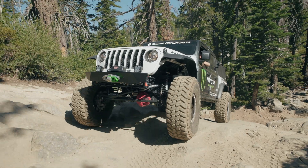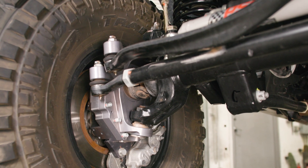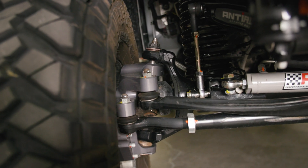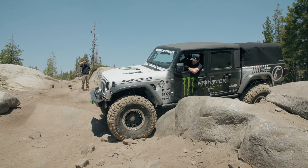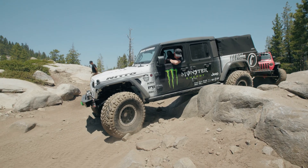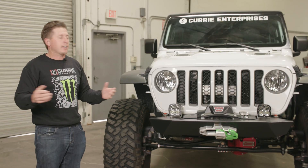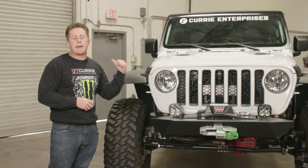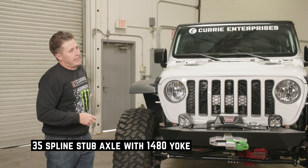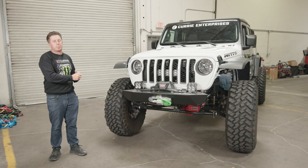We're able to run a 35-spline 300M axle shaft with our new two-piece 4340 yoke. Our new yoke design allows for outside ribbing rather than the rib in the middle so that we can maximize steering. A lot of the axles out there use the standard axle design, which is the limitation to how much steer you can get. With our new axle design, we basically maximized all the steering. With that, we're running our new stub axle as well — a 35-spline stub axle with a 1480 yoke. It's basically one-ton axle strength on a Dana 44 front end.